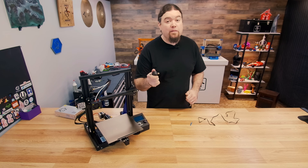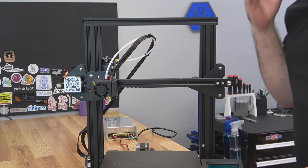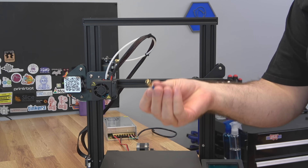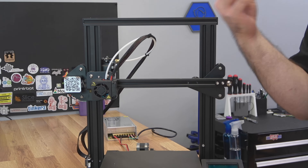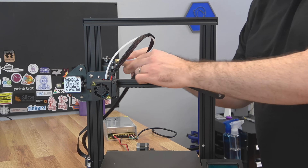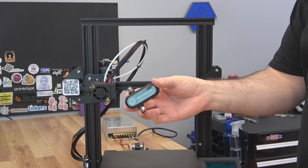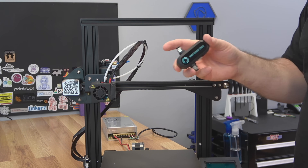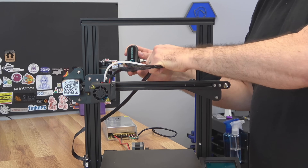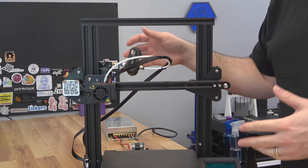Now let me show you how they intend for you to set this up on your printer. You can't watch a 3D printing video nowadays without seeing an Ender 3, right? For the Bowden setup, it's pretty straightforward. They give you a coupler and a piece of PTFE. You put this in place of your stock coupler — the Ender 3 uses the exact same one. You remove your Bowden tube on the extruder side, put a short piece of PTFE in the coupler, take your filament sensor, mount the coupler on that short piece of PTFE on the extruder, and then feed the tube that goes to the hot end into the other side. That's all there is for mounting. But just seeing this, I really don't like this setup.